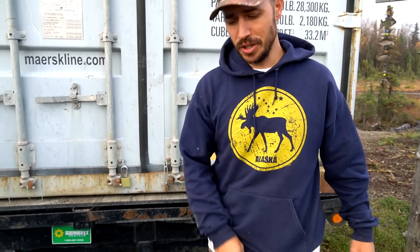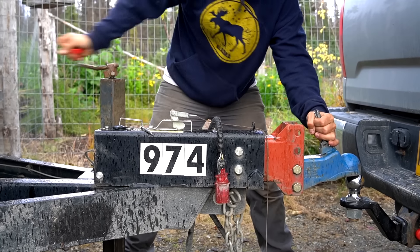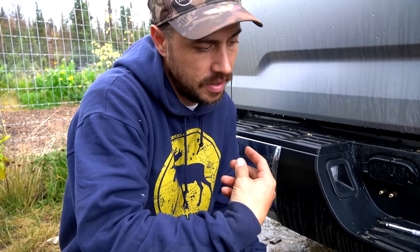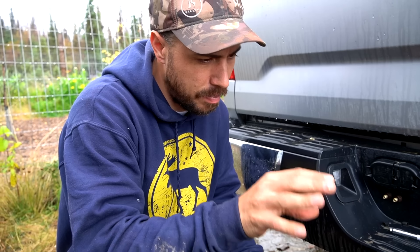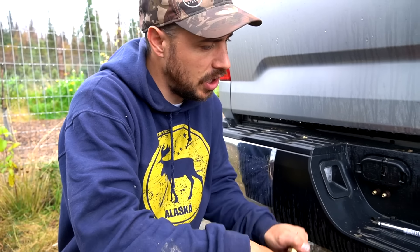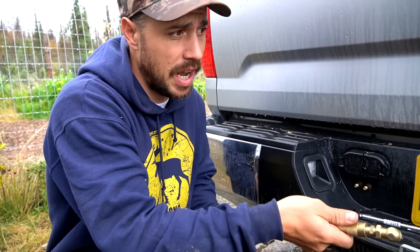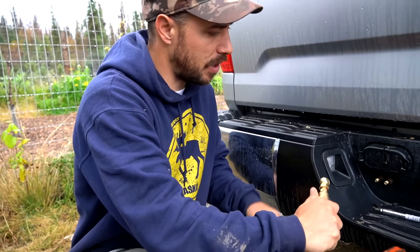We're ready to hook up the truck - let's get the Tundra hooked up to the Connex. We're going to get the airbags filled up on the truck. It's an aftermarket part. This one has them on the back axle and they can hold 80 PSI each. The back end of this thing is sagging pretty good with this heavy load. We're going to start with 50 pounds. These airbags are pretty cool - they give you a better ride and they're going to level out the back of the truck. You can actually see the truck move up when I put air in these things.